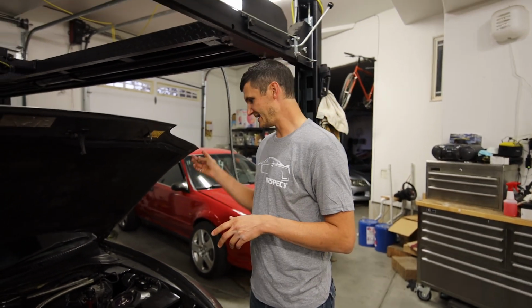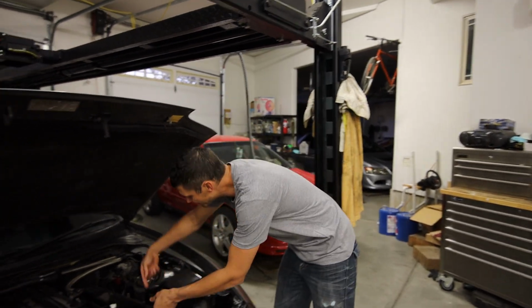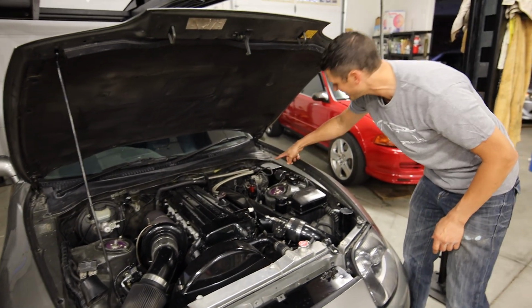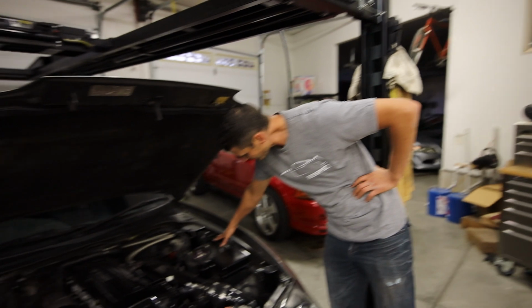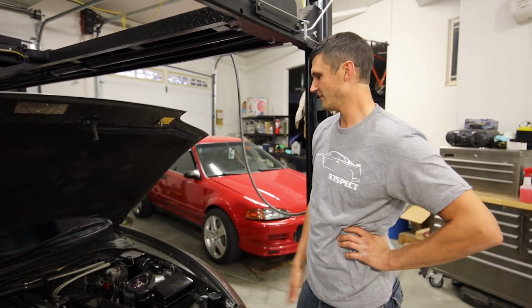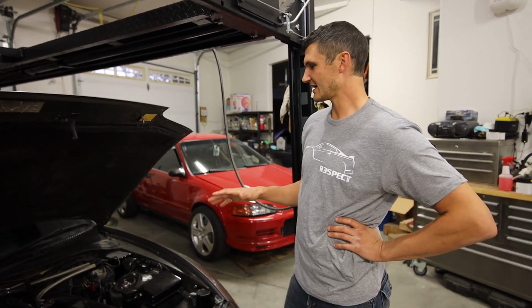What else? It's got dash 8 up, splits to 2-6, feeds both sides of the rail, then the return comes out the middle, runs over to the regulator, and then back through the flex fuel sensor, and then around and back. So I would say that's everything that's going on there.